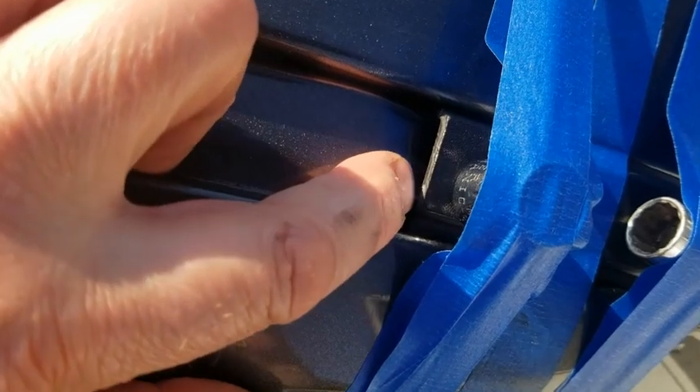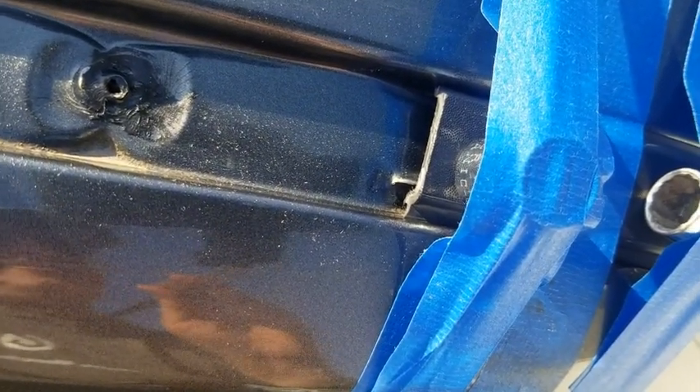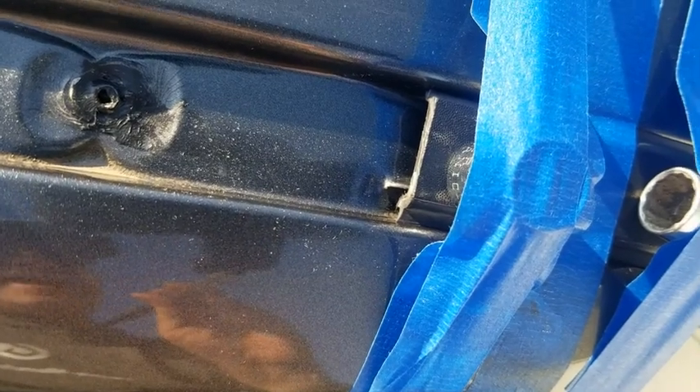See the little tab right here, this little piece sticking up? You need a cut for that on both sides — there's one on the other side too. Either that or there's gonna be a gap. So we're gonna make a little cut in our weather stripping, then stick it in here because we cleaned this whole track.